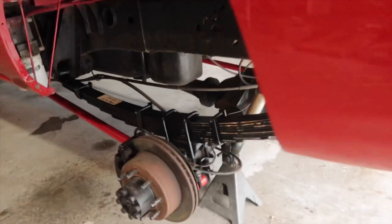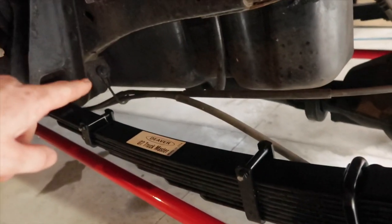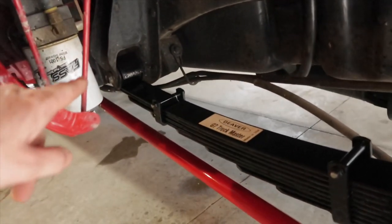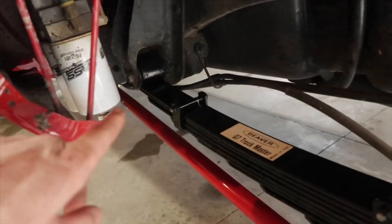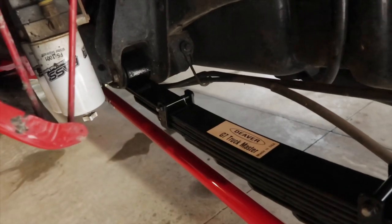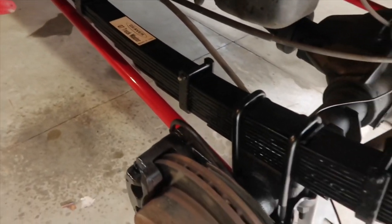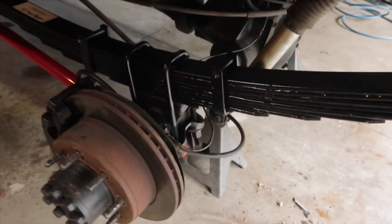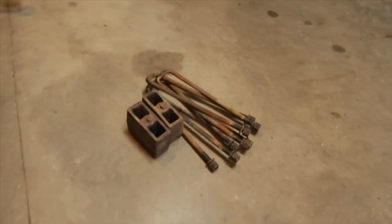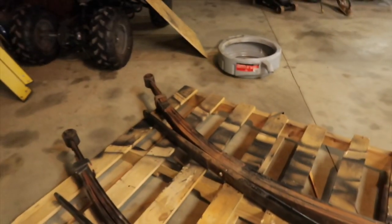So this is where we're at — everything is installed, I just have to put the wheels on. The hardest part was the fuel tank sitting right there; I had to angle the bolt down to get it out and reinstalled it in the opposite direction so the fuel tank isn't in the way if I have to take these off again. You're looking at a 10-leaf spring count versus the six-leaf springs on the stock setup. And by the way, if you want your rear end to sit up six inches, there you go.